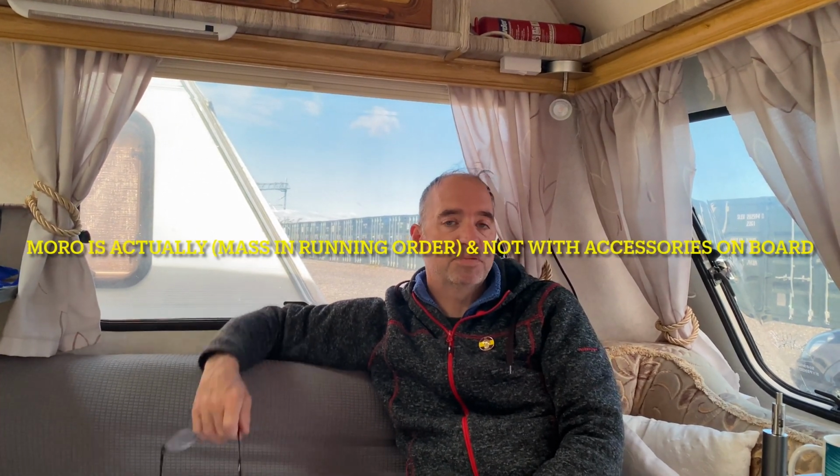Right, so we've got our kerb weight, which is, like I said, 1,540 kilograms. Now they talk about a caravan having to be a percentage of your kerb weight, 75%, 85 or 95% of that kerb weight. Like I've said before, we usually carry about 1,200 kilograms combined in our caravan. So our MIRO is about 1,200, so that puts us around 80% of the kerb weight. Say 85% is roughly where you need to be, that's 1,232 or 1,300, somewhere around that figure.